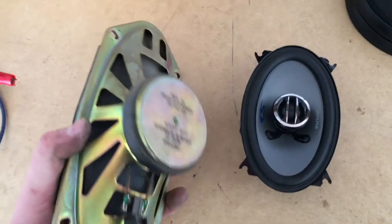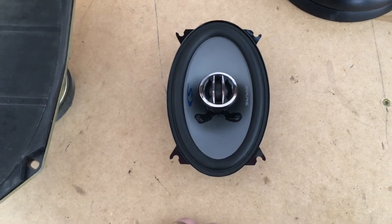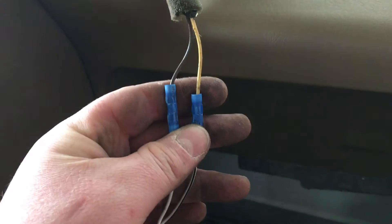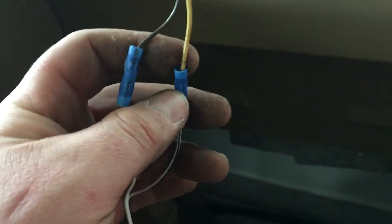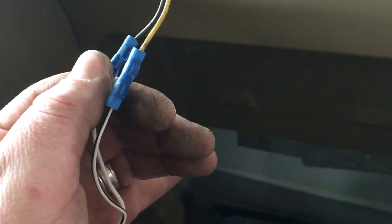These were held on in the panel itself, but since the four by six fits in that location we'll actually mount this directly to the middle. Now before I get that speaker in there, here's the wiring harness. What I've done is cut off the old harness and wired in my harness adapter which plugs into the new speaker. Within this harness the negative is the yellow and the positive is the brown, and you strip both ends and use butt connectors to connect the wires together safely.